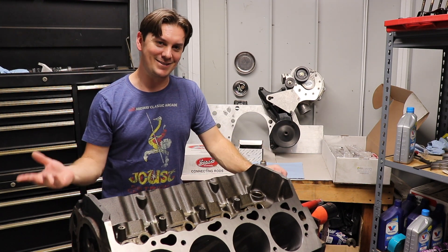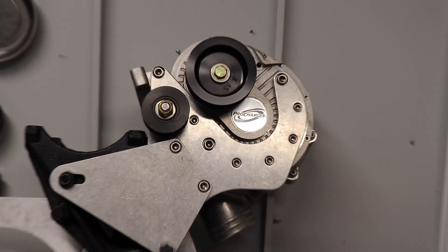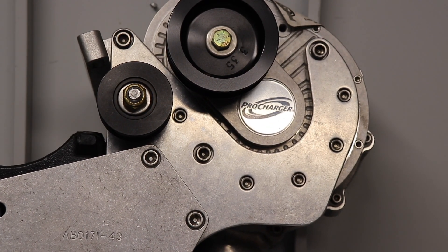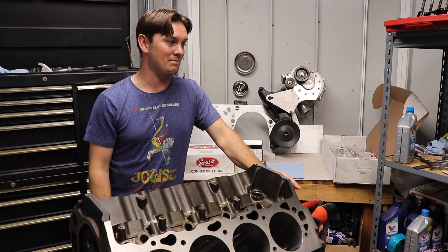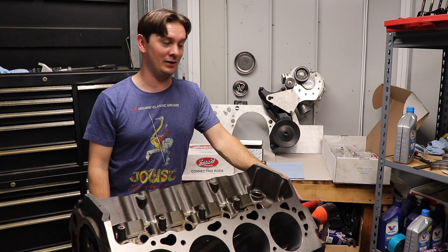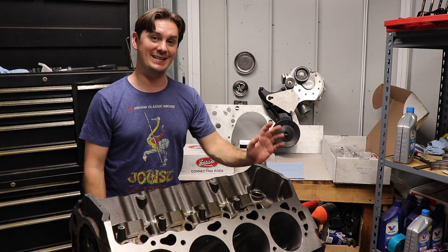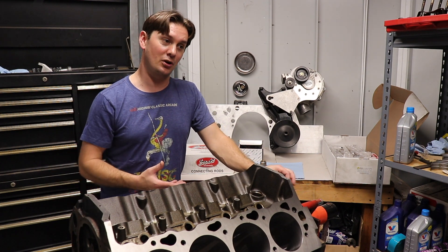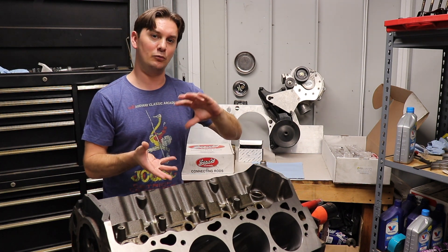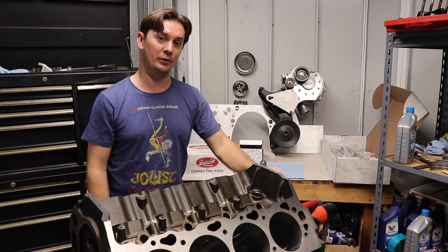The other problem I ran into, which kind of helped with this decision, was mounting the Pro Charger. On the last episode I told you I was going to call them up and see if I could get brackets. They wanted like $1,500 for universal bracketry, and it re-clocked my Pro Charger, which I didn't like. Even then I had to ship it to them so they could break it open and rotate the insides — there's an oil slinger in there that supplies the whole thing with oil.